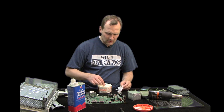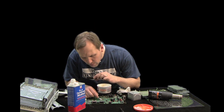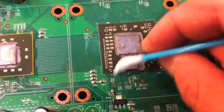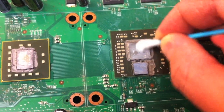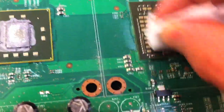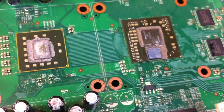Clean off the other side, then gently rub it onto the processor — just the surface — to clean it off. Get another Q-tip with rubbing alcohol and clean it off as best you can. You don't want any extra fibers in there either; this gets very hot and you don't want any foreign matter in there. Do that to both chips.